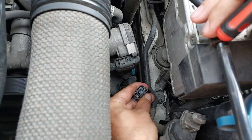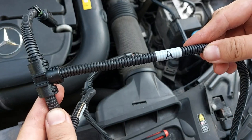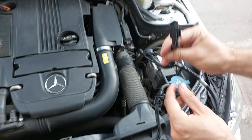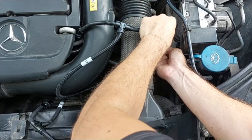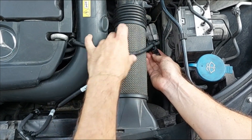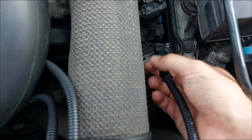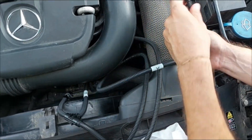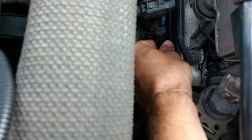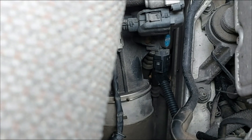The original male connector is out. Then I'll grab the part of the harness marked A, look for the female connector and insert the original male plug into the female connector on the harness. You can reinsert the gray locking clip now. Then you just insert the remaining male connector into the sensor and you're done here — just make sure you push them all the way in.